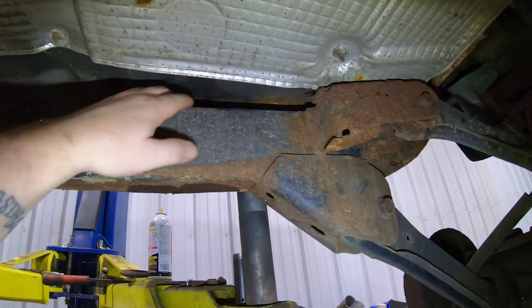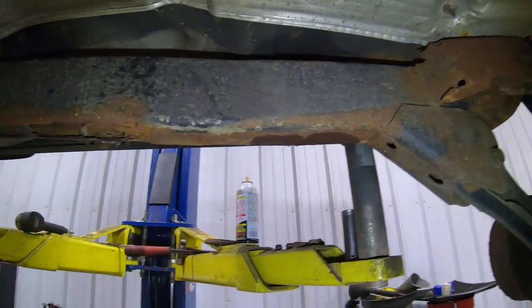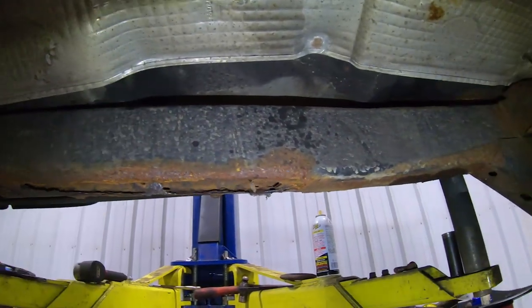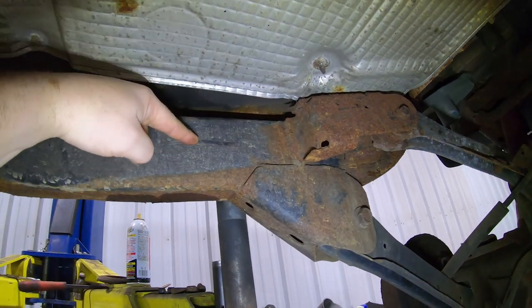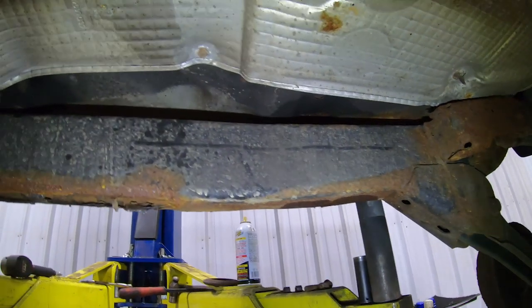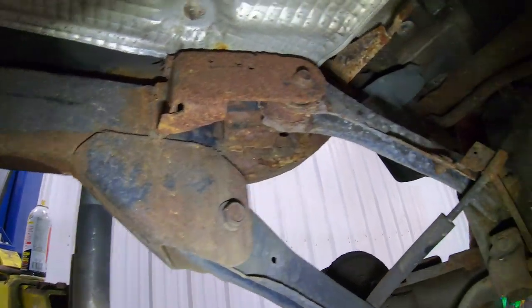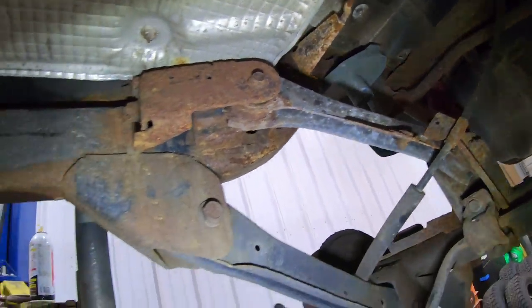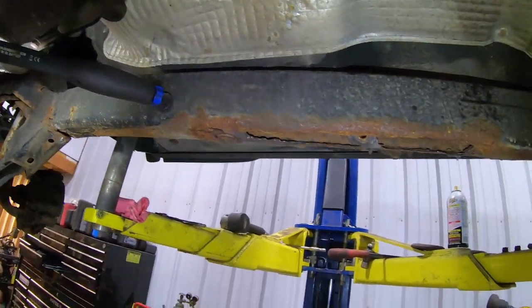This is nothing out of the ordinary. We do still have good frame up top with a little bit of surface rust and some dirt, but we don't have that big of an issue. So we're going to cut this one kind of high - probably right about there, which is a little bit more than halfway - just so we can get the most amount of rust out of this frame as possible. I'm going to hit it with the needle scaler so the plasma cutter doesn't have such a hard time with it, and then we'll get this whole section of the frame cut out.